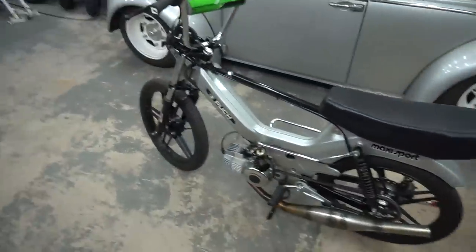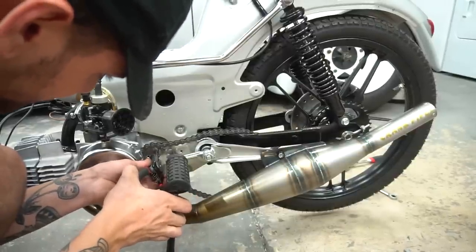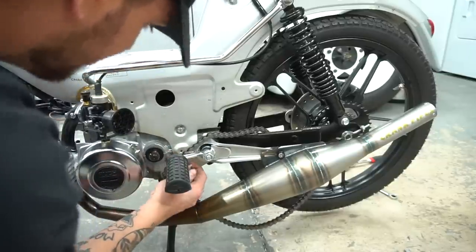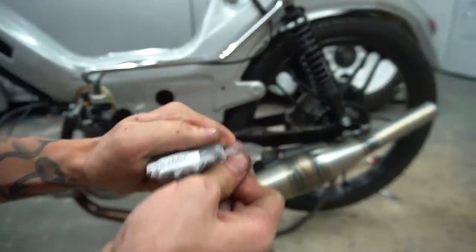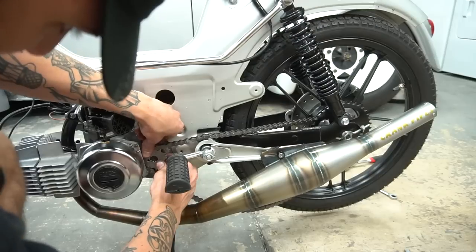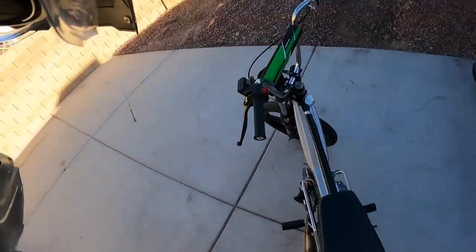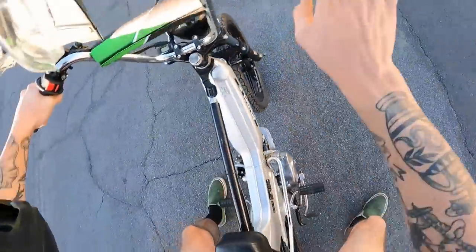The Pook rips in the top end, but we've got to change some tuning and work on the bottom end. We're going to pop the sprocket — the chain doesn't really want to come off the front sprocket so we might pop the whole sprocket off with it. We've got a 15-tooth in there now, and we're going straight for the 13 to really see the big difference, then we can go back and forth from there. We're now running 13-tooth with a 38-tooth rear sprocket.